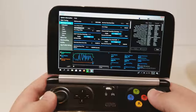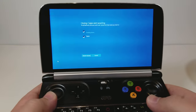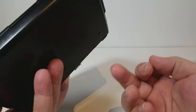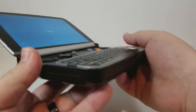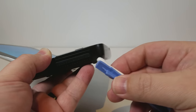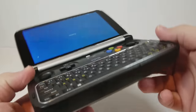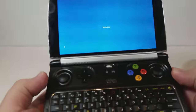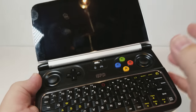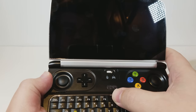Let's go ahead and shut this down as we have to restart it. We're just going to be taking off the seven screws — eight if you include the SD card slot — all of that has to be removed, and we're going to use a plastic spudger to go all around. I'm not going to do that all over again; you can just look at my how-to replace the battery video, which I'll link in the description, to see a full teardown. So we'll just jump ahead and take a look directly at the heat sink itself.